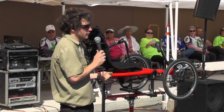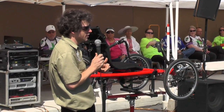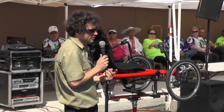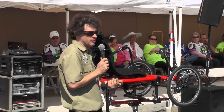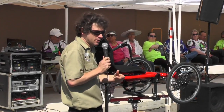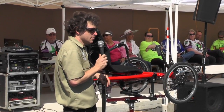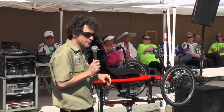The wheels and the drivetrain are in motion and they move differently, so you can identify whether it's a wheel problem or a drivetrain problem by what's moving and how fast. If you hear the noise coasting downhill but not pedaling, it's the wheels. If the faster you pedal — or you change gears so you're pedaling faster or slower — and that affects the noise, then the problem is coming from the drivetrain.